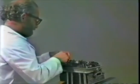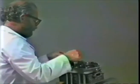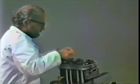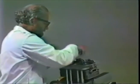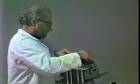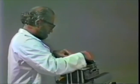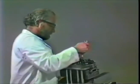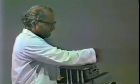That's why I like to use a wrench on them. You can torque them down to between 15 and 18 foot-pounds, but I think you're much better off going closer to 15 than you are towards 18. They tend to strip out at about 18 or so. So on the intake rocker stand, it's kind of best usually to torque down the middle nut and then go over to the outside ones and torque them down evenly. If you do one of the outside ones first and an intake rocker happens to be open, then you can put kind of undue stress on the rocker stand, etc.